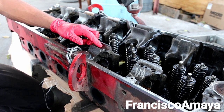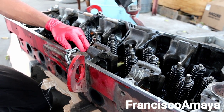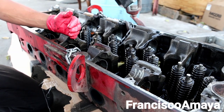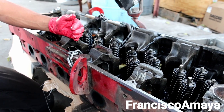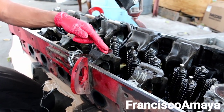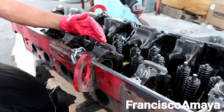If you have a Cummins ISX with around 400,000 or 500,000 miles and you start feeling that oil pressure no longer goes above 30 or 35 psi when it used to reach 40, you are probably experiencing cam wear or crankshaft main bearing and rod bearing wear — all of those could have significant wear.